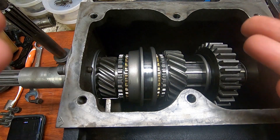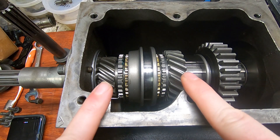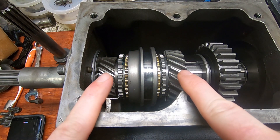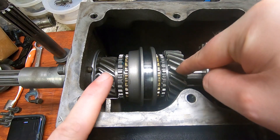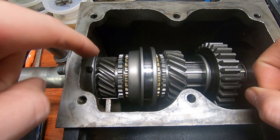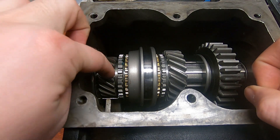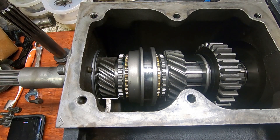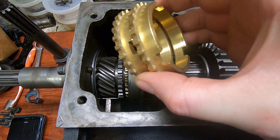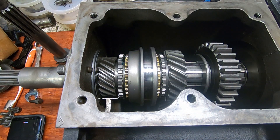I think it's the gears. So we're gonna focus on changing out the gears with some proper US made parts. I have a new old stock second gear and a well-made main gear coming in, and we'll swap those in with the same blocking rings and see what happens. Failing that, we'll throw the Crown blocking rings at it and see how that goes.